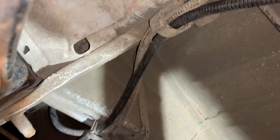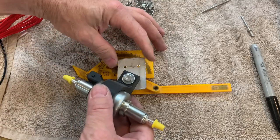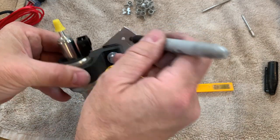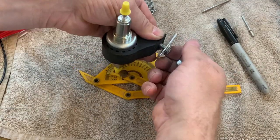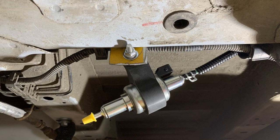The next thing I'm going to be installing is the fuel pump. The manual suggests that the fuel pump should be installed with the intake lower than the output. Here I have made a small bracket out of scrap aluminum to lower the pump slightly and to capture the angle prior to crawling underneath the vehicle. With the bracket riveted to the frame, I just aligned the fuel pump with the felt markings and tightened it into position.